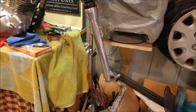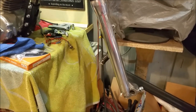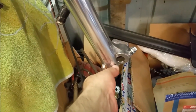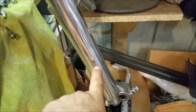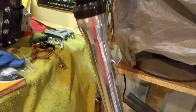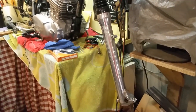I've elected to polish the leg on this fork. One reason is because the clear coat was half off. So I've decided to polish it to make it look a lot nicer. The polishing process took about half an hour from go to wait. In terms of the battle scars down here with some black polishing compound in — I'm going to take that out with a bit of Prepsol or thinner and a toothbrush. The best prevention for corrosion is a bit of light machine oil on a rag just to wipe up and down the legs every now and then.